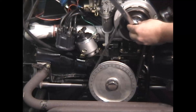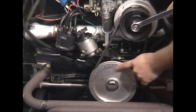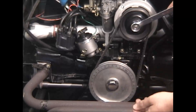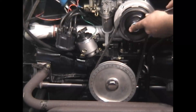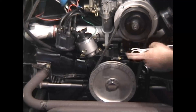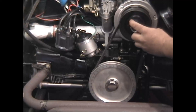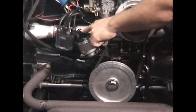Next, we're going to start rolling the motor over clockwise. We're paying attention for top dead center on the degree wheel pulley, or on our stock pulley that we marked. We're waiting for top dead center to come up, and we want the rotor in the five o'clock position. Just going to roll it over until we get there. Here comes top dead center — we're on our mark on the pulley and the rotor looks good.